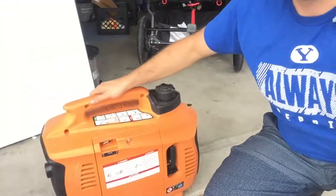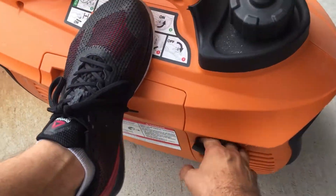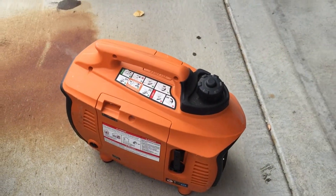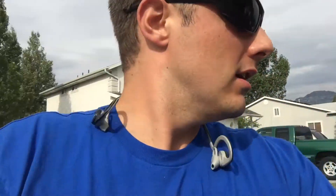Okay, she's running. Gonna go for a few minutes and then see if it starts by itself again like that. Now here's the problem — I'm guessing it's starting because the carburetor cleaner was in there, giving it an initial catalyst. I didn't quite get it off all the way to clean it, and it felt like it wasn't coming off. I know I've seen somebody do it, so I'm gonna have to pull it all the way off and really clean it instead of just spraying the inside. Jared says I need to take the carburetor all apart and soak it in brake cleaner or carb cleaner to break it up.